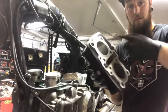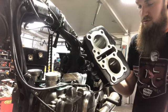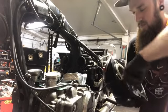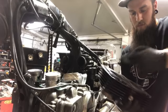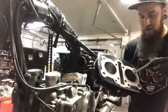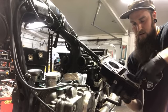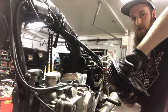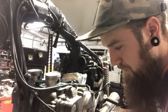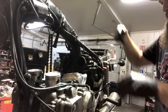What I am going to do is oil up the cylinders, okay? Not a lot. Just put a little drop in it, use my 2 fingers and coat the inside. So when you go to start it up, it will smoke, but a thimble of oil in the cylinder will go forever. It'll smoke forever, so I'm not worried about that. All right, so we got oil in the cylinders. Now it's time to grow a 3rd arm and put this thing on. Having your buddy there with you is always easier too, but the shop's closed today.